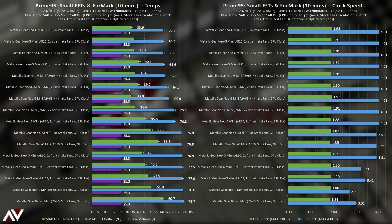These are the results from the experimental portion of testing, where I tested different configurations with Prime95 for full CPU load and Furmark for full GPU load. The graphs are ordered by CPU temperature — hottest at the bottom, coolest at the top. All fans were spinning at 100% speed in every test to remove fan curve variables. Temperatures are logged in degrees Celsius in a delta T format; add about 20 degrees to get the true component temperatures.